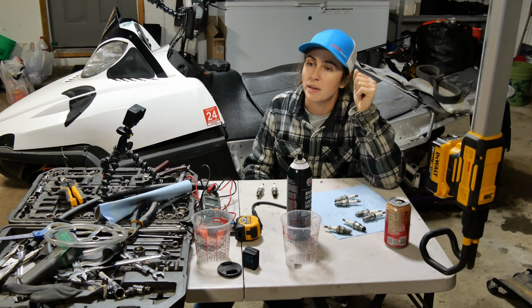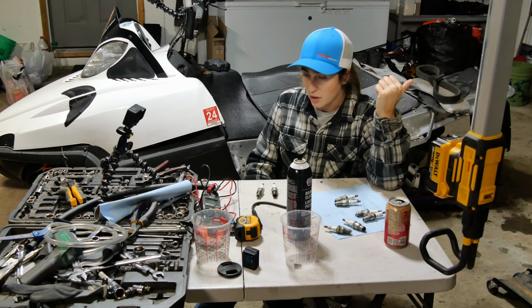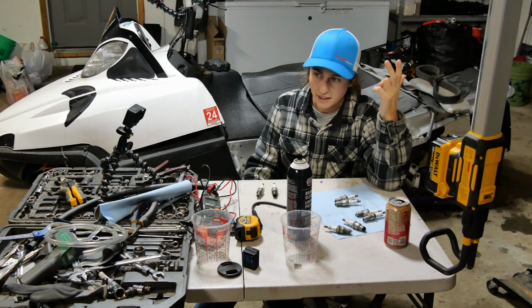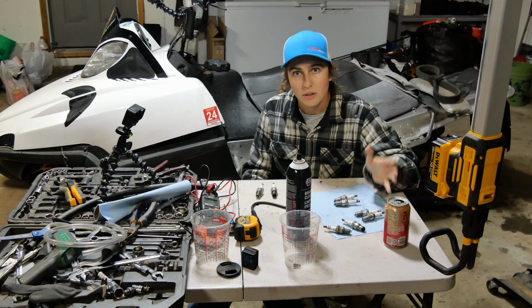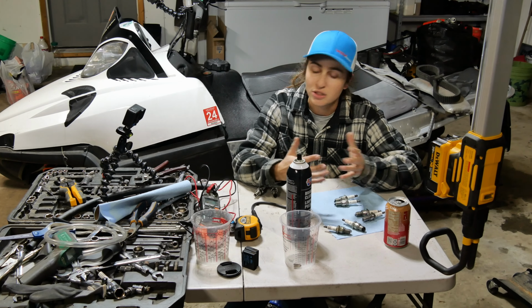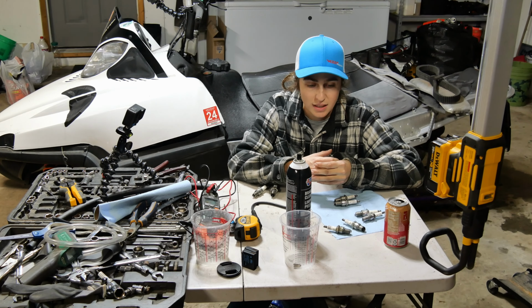to this snowmobile. So we have put a new stator in the snowmobile, we have put a new coil in the snowmobile, we have put a new rectifier in the snowmobile, and now we just tried a new ECU in the previous video. If you guys want to go back and watch that, you can see what it did. It just died on the trail, just like you hit the kill switch.